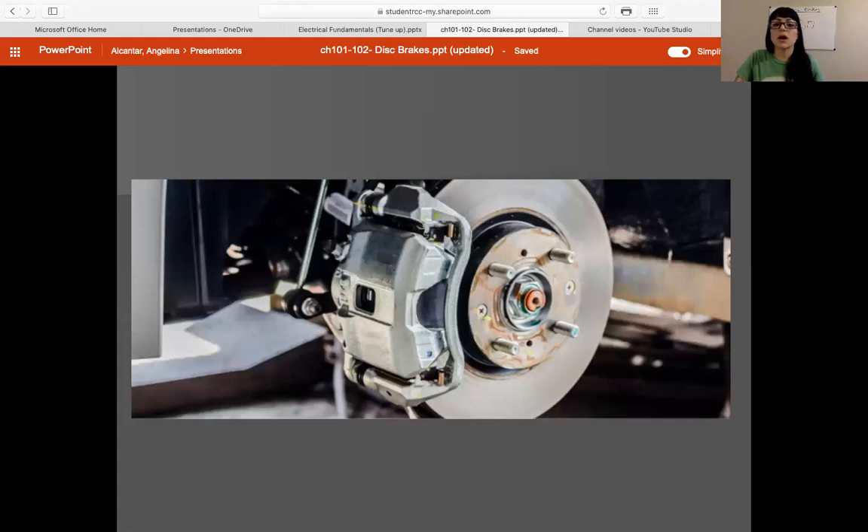Here's another picture of your sliding caliper grease. You can always tell a sliding caliper because it has slide pins and little dust boots on them. On a sliding caliper design only, there is a frame where the caliper mounts to and then the caliper housing — they are two separate pieces. What's nice about the sliding caliper design is you can always just undo the bottom bolt, flip the whole caliper housing up and gain access to the pads. But if you need to take the rotor off, the whole housing and frame needs to come off as well. Here's another example of a floating rotor as well — you can see the little hold-down screws.